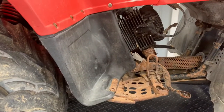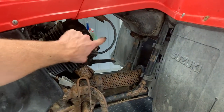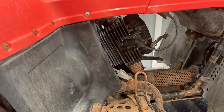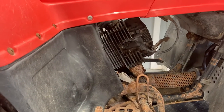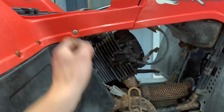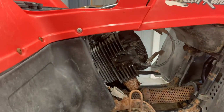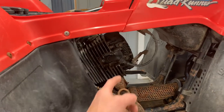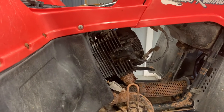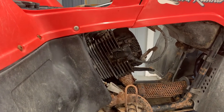I'm going to show you that a little bit more when we get to the back end. On the motor, a common question is about this lever — it's a decompression lever. Some of the newer four-wheelers have automatic decompression; this one's got a lever here. You push it down and pull-start your four-wheeler. That lever should automatically kick up when the four-wheeler starts. What it does is push the valve down and open up compression a little bit so you're able to pull-start a little bit easier.